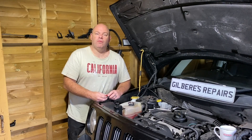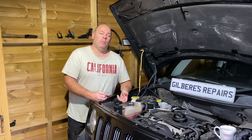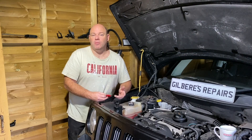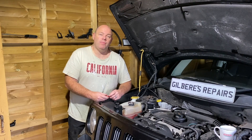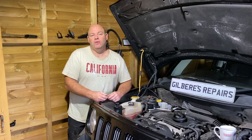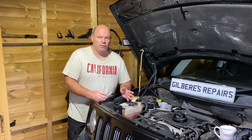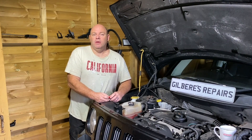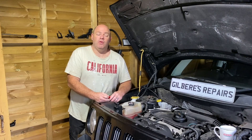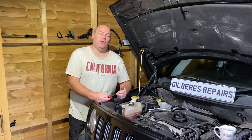So there we have it — we've resealed the sump. If you were replacing the sump it's the same technique: drop the old sump, put a new one up, clean it the same, and reseal it with the same jointing compound. There were no leaks on the run-up. This is on the Volkswagen 2 litre TDI 140 horsepower turbo diesel engine, fitted to this 2010 Jeep Patriot but also to Volkswagen Golfs, Passats, and many other VAG vehicles. Very successful. If you found this useful and it gave you the confidence to carry out the job yourself, please like, subscribe and share, and I'll see you on the next video.